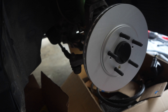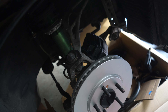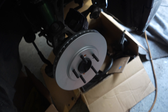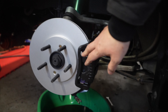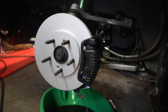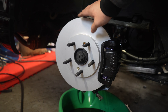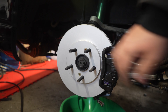Rock Auto just showed up. We got the front rotors in place — we just need two new caliper bolts to fit the caliper bracket back on, since the Wilwoods used different bolts for their brackets. We had to order new metric M12 by 1.25 for the front as well as the rear. This is just mocked up for now, but you can see how good the painted calipers came out — really nice; I'm a big fan of doing all black. The rotors are from Dynamic Friction, the coated kind, so they don't come with any oil or grease. Once the pads apply pressure and break it in, it'll expose the surface, but everything else is coated and will not rust.